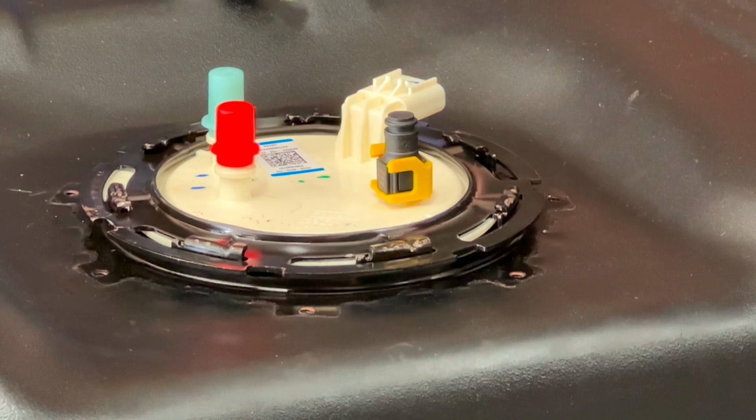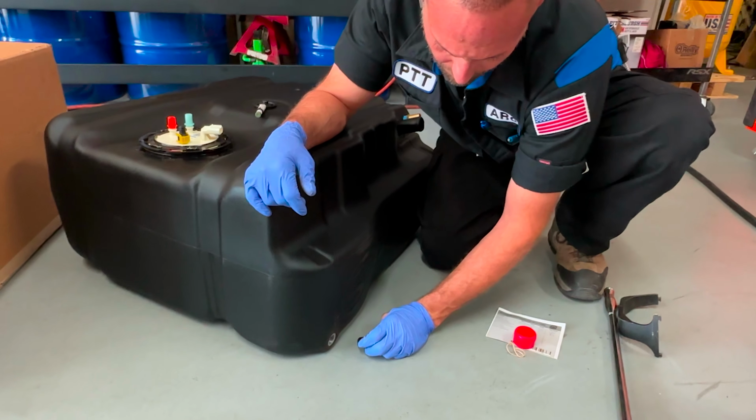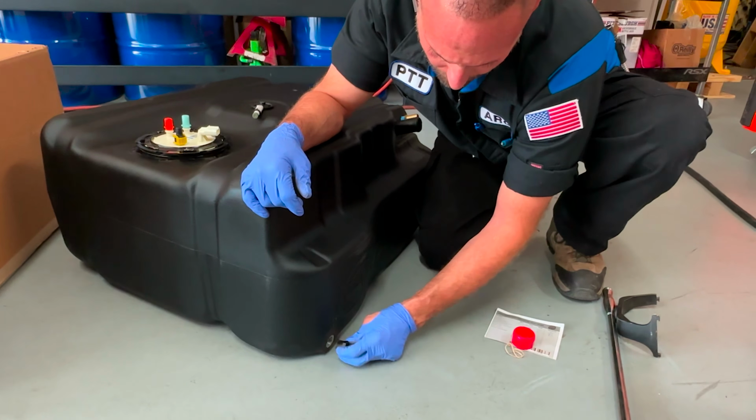All right, the next step, also here, I guess we'll make a point to this. If you needed to drain your tank, no, if you pull this out, it's not gonna start draining. You have to drill that hole out. If you guys have watched the one video where we installed the siphoning part on a 60 gallon, we had to do that same thing. It had one of these at the top, same concaved port in there where we took a little coping saw, and I held this under the hole and collected all the plastic shavings so that when we threaded in that steel rod, we weren't messing around, because we don't need to just leave that open. So let's put this back up here.